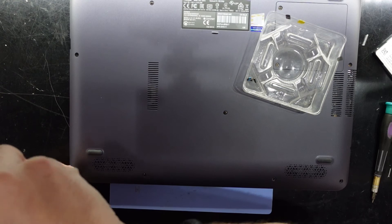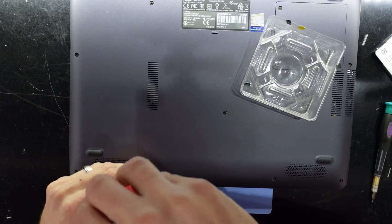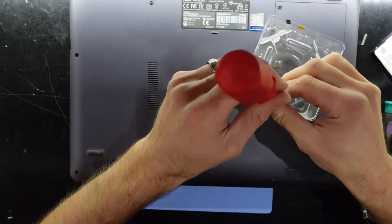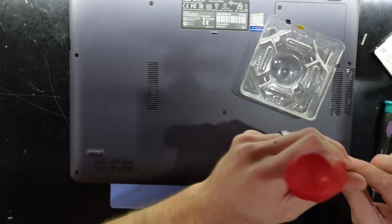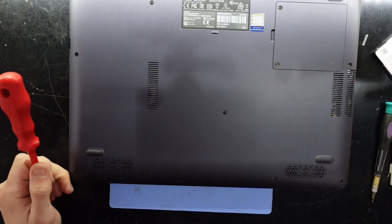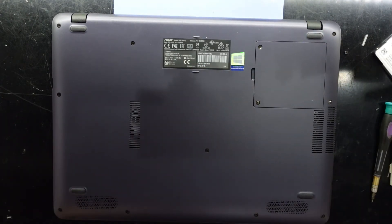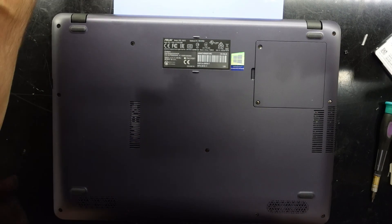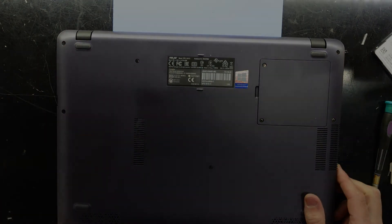And finally the last four go across the front. If you have replaced your hard drive just like I've done here, you're going to either have to use a Windows 10 reinstall USB — which you can make by Googling the Windows 10 creation tool on a working computer — otherwise you may be attempting to ghost it from the old hard drive to the new one, but that would require software you'd probably have to pay for. So I'd say a fresh install of Windows 10 would be the way to go, as I'm going to do now. So that's how to replace the SSD — or replace to an SSD — in your ASUS X507U. I hope that helps you. See you later, bye-bye.